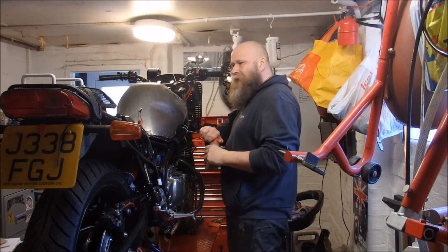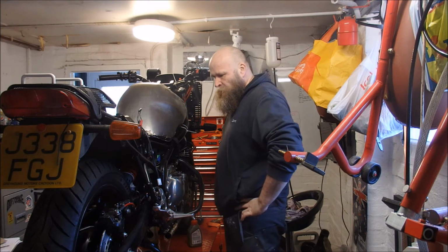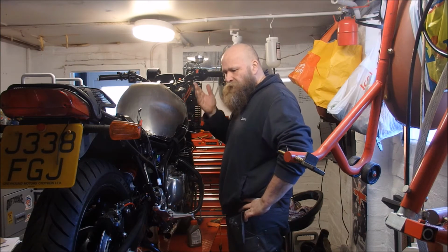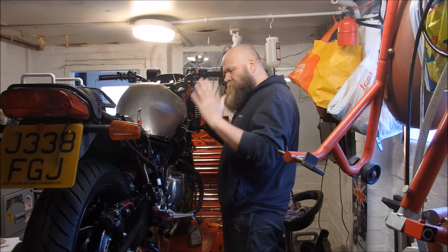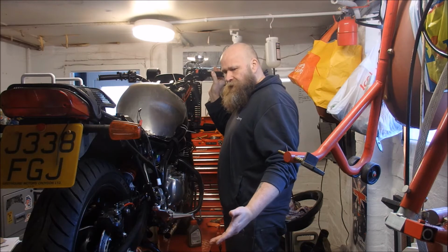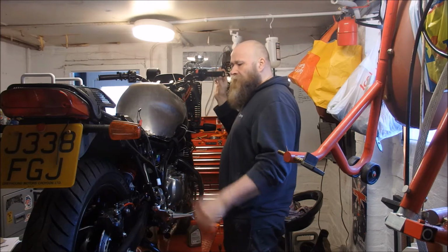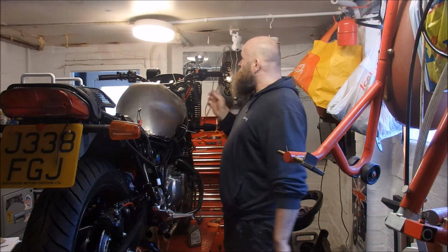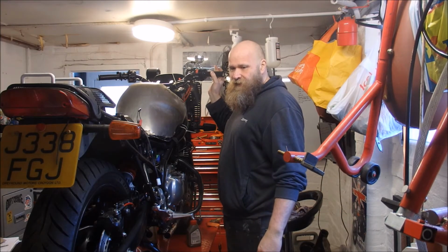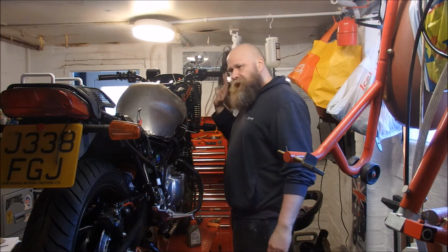Okay guys, not entirely happy with the brakes as they are. It's a pain. I think ultimately I'm going to have to end up taking one apart and making sure that the pistons move freely. There was air in the system, I did take air out of the system, I've pumped the brakes out, and they feel okay now, but let's find out. The only way you're going to find out is by going 10-15 mile an hour on a good straight road and then seeing if the brakes apply. We'll see. I'm not 100% happy with the brakes.